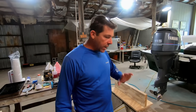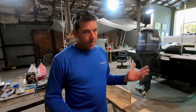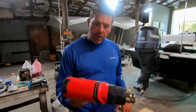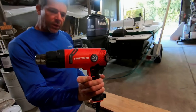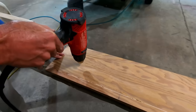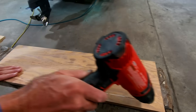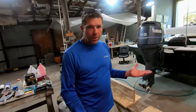You also want to make sure not only is it clean with an aggressive texture, but you need it to be dry. If it's damp or has high moisture content, resin and water do not mix — it's not going to stick. I've got a Craftsman heat gun — it's like a commercial-grade hair dryer. You can buy these at Lowe's or most good home stores — I'll link one below. What you can do before you start glassing is warm up that surface, continuing to move back and forth and periodically feeling if the material feels warm. You don't want to stay in one spot because these put out an extreme amount of heat and there can be a fire hazard, but you can also put the material out in the sun.